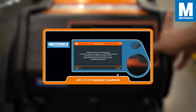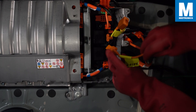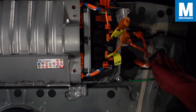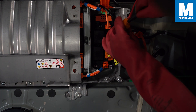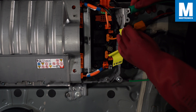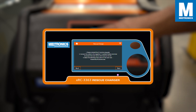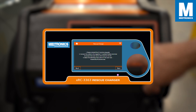You need to perform several steps now. Please reinstall the high voltage service plug grip. Then connect the cable to the negative auxiliary battery terminal. Then connect the scan tool to DLC3 and turn IG on. Select the following menu items in the scan tool: powertrain high voltage active test.